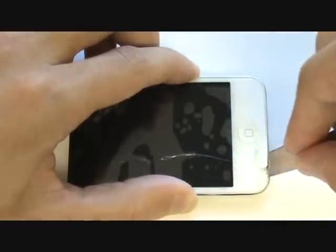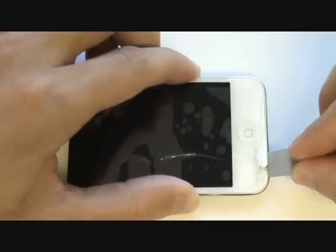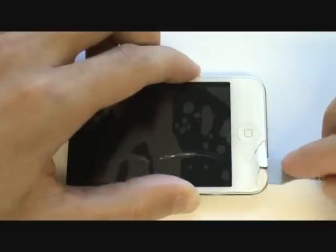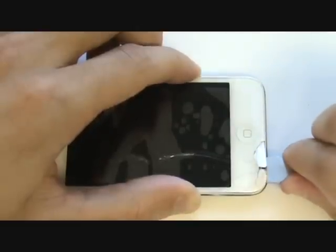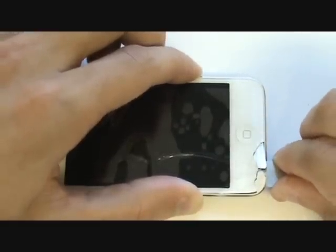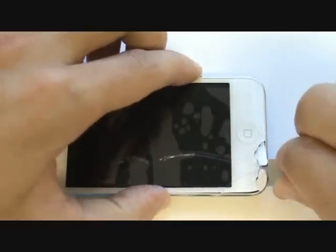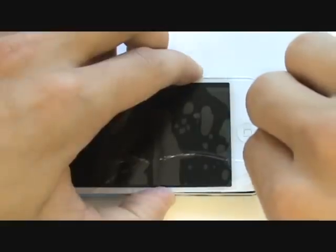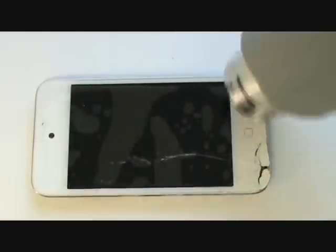Sliding the tool toward the center will give us all the leverage needed to lift out the screen. When prying in areas where the glass is badly cracked, the glass will break up and make removal more difficult — in general, the more intact your screen remains, the easier the repair. Avoid prying directly underneath the home button, and do not pry in the top portion of the screen. There are many components in this area that can be damaged. Continue to apply heat as necessary; keeping the adhesive soft around the perimeter will make removal less challenging.